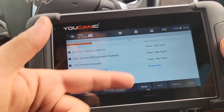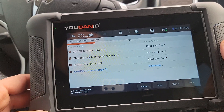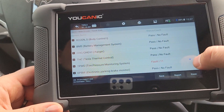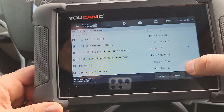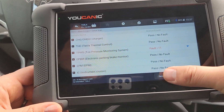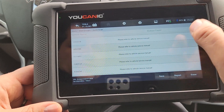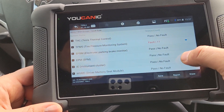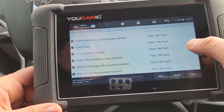You can see several of them have no fault codes, but there are going to be a few that do have codes. The scan is complete. You can see the control modules that are installed on this car. You can enter any of them by selecting them. You can save this report or email it. If you click the arrow, you can see the codes. Usually you can see a more detailed description, but on this TPMS the fault codes don't really have detailed descriptions. Those are the only codes we see.